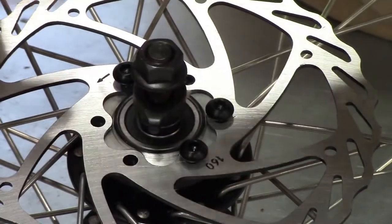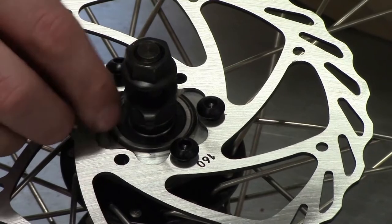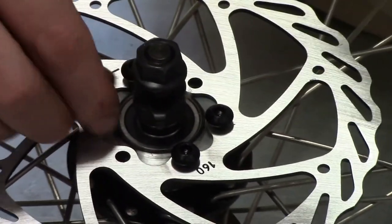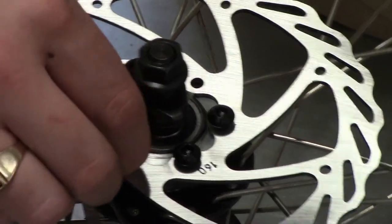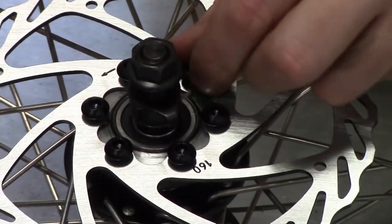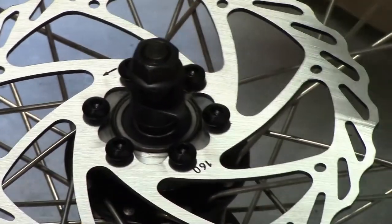The way you will tighten these bolts is to actually do them cross from each other. So we don't just tighten one and go round the circle. We tighten one at say 12 o'clock position, and then go and do the one opposite at 6 o'clock, and then go to 3 o'clock, and then 9 o'clock, and so on, until everything is tightened.